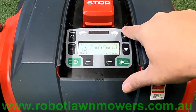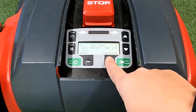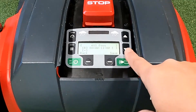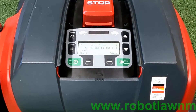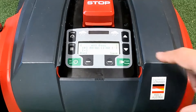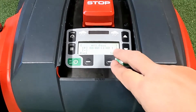Press continue and it goes to the start time in hours — currently set at 7am, so we'll change that to 8am. You can also change the minutes if needed. The stop time is currently 10am — we'll make that 11am, so it runs for three hours. The last setting is which entry point it's going to start on. When you have it on all days, you generally leave it on the question mark. The question mark means the robot will randomly and alternately start mowing at those programmed entry points — zero, one, two, and three in turn. If no entry points are programmed, it will just start off the base station each time.